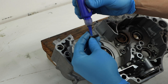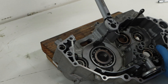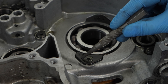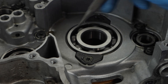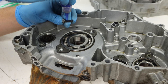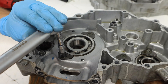We can now throw in our retaining plates. Make sure to put some blue Loctite on these bolts if your service manual calls for it, and then torque down the bearing retainer bolts — about 8 to 10 foot pounds on most bikes, but definitely check your service manual to confirm for your bike. A little trick: the bolts are punched in by the manufacturer, so I switched the bolts so the old punch mark faces away, allowing me to get a new punch mark in to make sure the bolt stays in place. When making these punch marks you need to be pretty forceful since the metal is hard. Also, if you're using an impact, don't tighten down the bolts with it — just get them snug, then use your torque wrench to finish them off. You really don't want to strip out any heads this far into the engine.